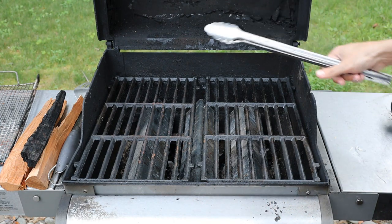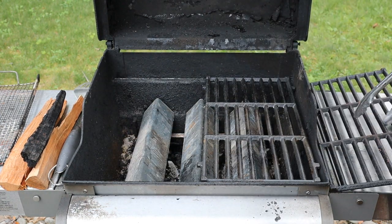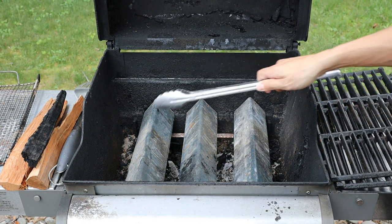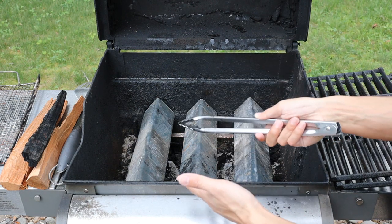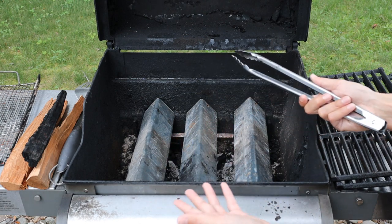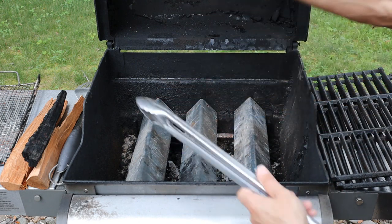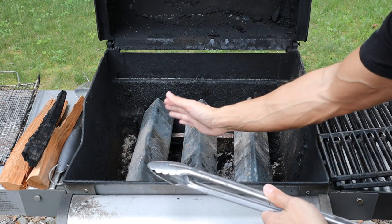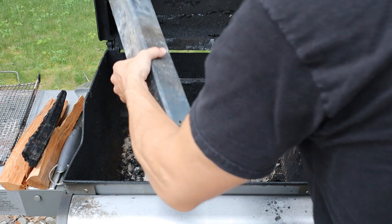Now this is how the grill would look normally — you have the burner grates down there and the grill grates up here. We're going to remove these heat distribution plates. Underneath are the burners — one on the left, one on the right. What these plates do is allow the heat to go somewhere so your grill warms up. Normally you turn this on, wait 5 to 15 minutes, and your grill is hot and ready to go. If you take these plates off, the grill won't heat up the same way because the grates are pretty far away from the burner itself. But in order to have it wood-fired, we take these off and expose the burners.